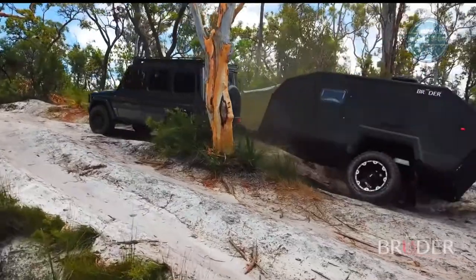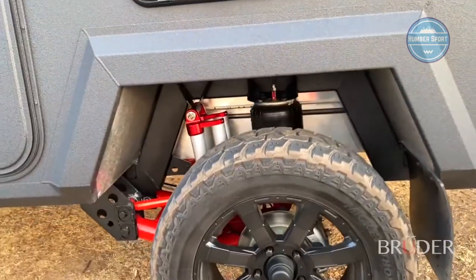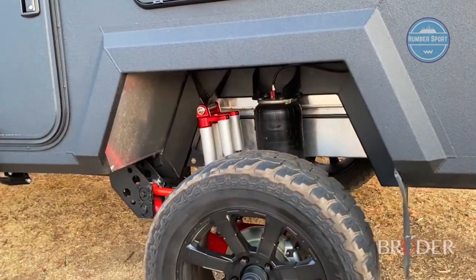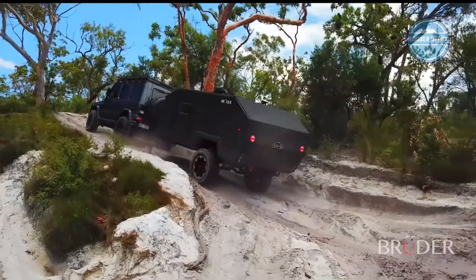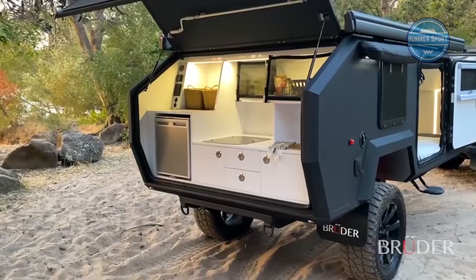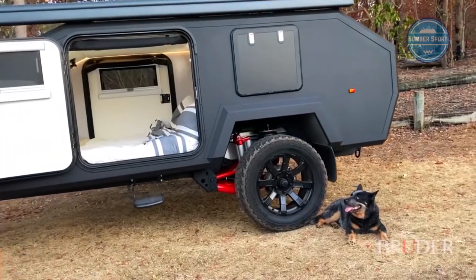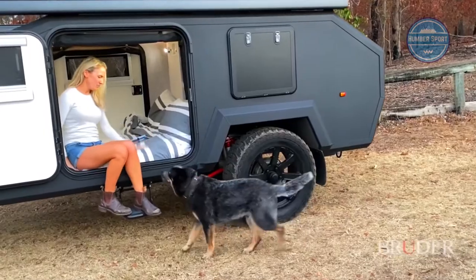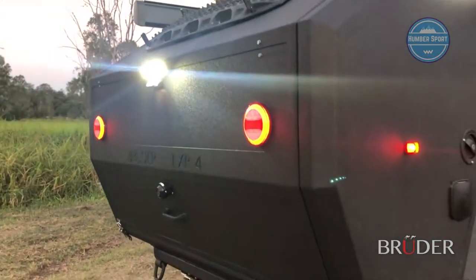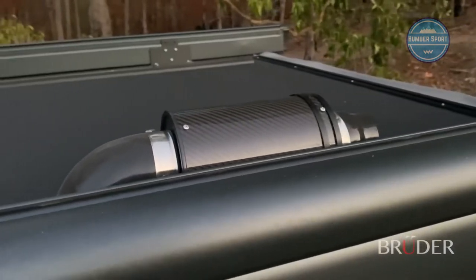For perfect towing balance, the suspension can also calibrate its ride height to suit a wide range of tow vehicles. The EXP4 has nearly tripled the adjustable wheel travel of the nearest air suspension system. This suspension is only available on Bruder Expedition trailers, made from Australian 450-grade high-tensile circular hollow-section steel, and shaped to maximize ground clearance. The exterior can also be fitted with mounts for 4x4 recovery tracks and similar items.